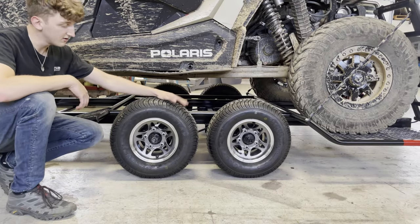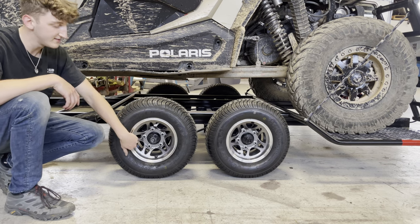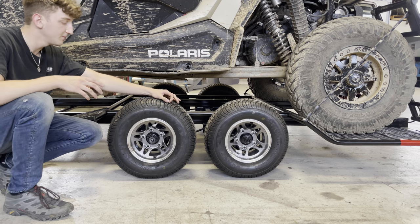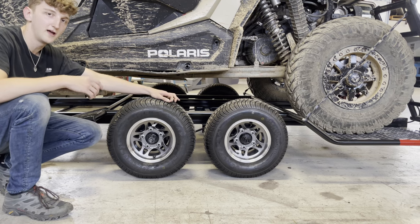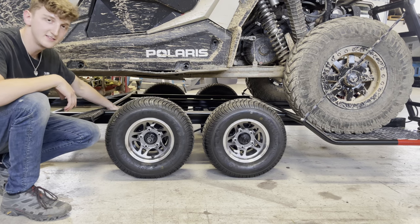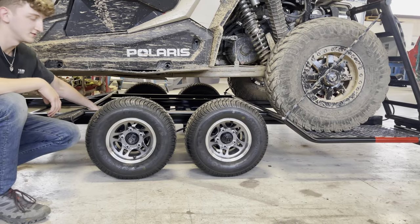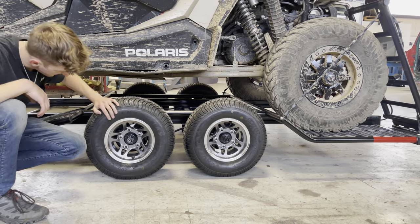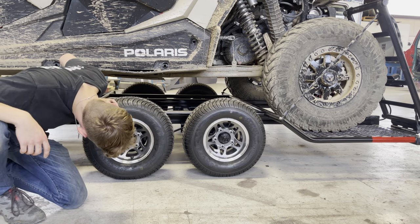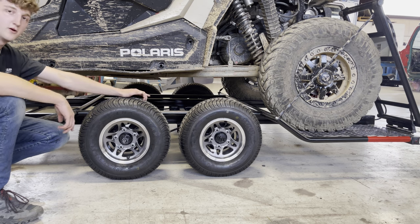Now the wheels. These are 20.5-inch wheels, about 8 inches wide, and they sit on a 10-inch rim. They're load range C, so they both have about 1,100 pounds of max weight each — two 1,100-pound tires on one single 2,200-pound axle, which comes in perfectly at 2,200 pounds. The PSI is 50 — just 50 PSI for max load at 1,100 pounds.